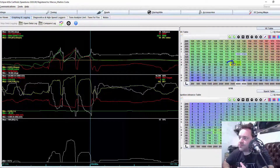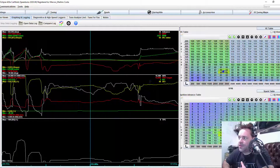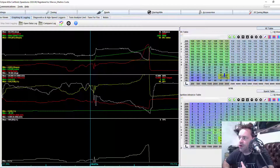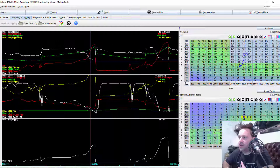And then you see here again, it seems that everything above a certain point is a little rich, and some other areas down here are a little lean. The areas I'd be more worried about being lean are where we've got boost. We have a long stretch and then a big run — this went up pretty good and we got on boost.